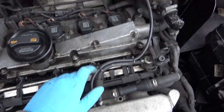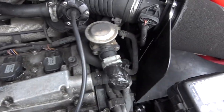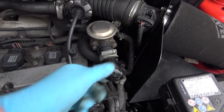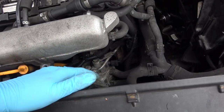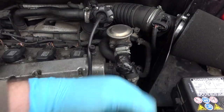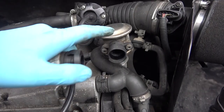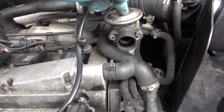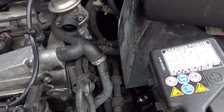This is from last week on the delete video. This here is the secondary air intake sort of manifold. It draws vacuum and uses the secondary air pump. The secondary air pump has been removed already off screen because it was rattling around like an absolute nutter. This is just basically stopping the exhaust gases from coming out. Now it's a simple little pipe — if that's not there, the exhaust comes out of here. I think there's a blockage further down, but we can leave that off. This needs to come out, which means all of the actual induction system needs to come out so I can access the coolant manifold down the bottom.